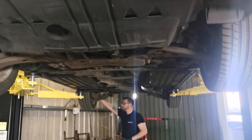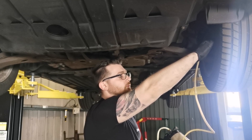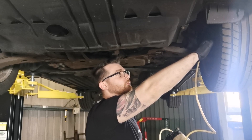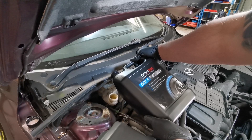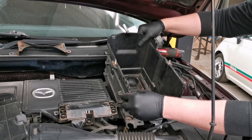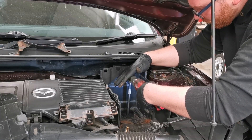Because there might be an airlock in the ABS pump itself, you may have to carry out this procedure multiple times to make sure all of the air is out of the system. This can be a tedious job, but your patience will pay off. Remember to keep your fluid level topped up so it doesn't drop too low and draw in air. When you're happy it's bled, all the air is gone, and there are no leaks from the ABS pump, you can refit the battery.